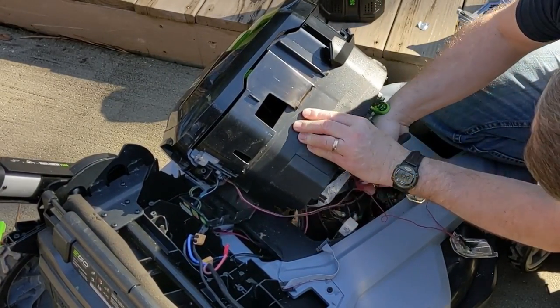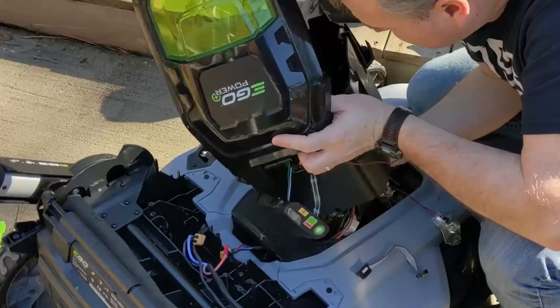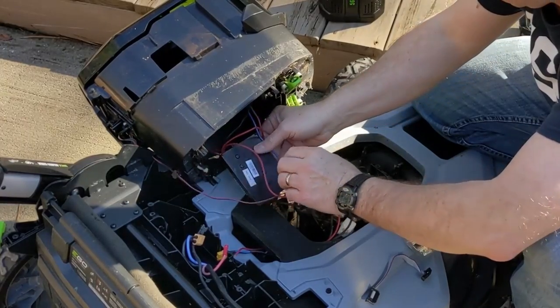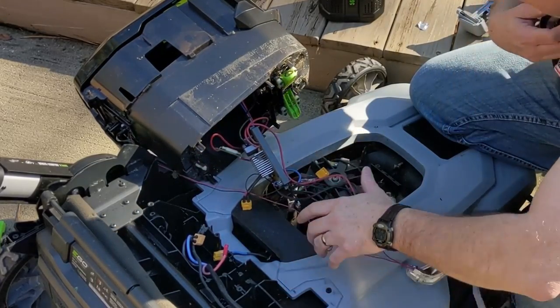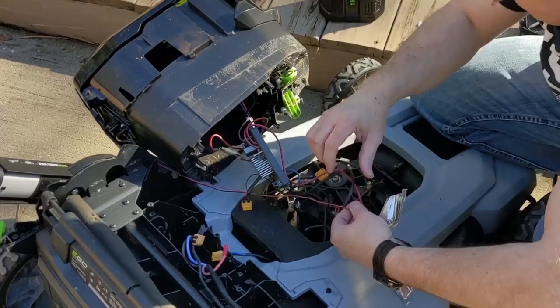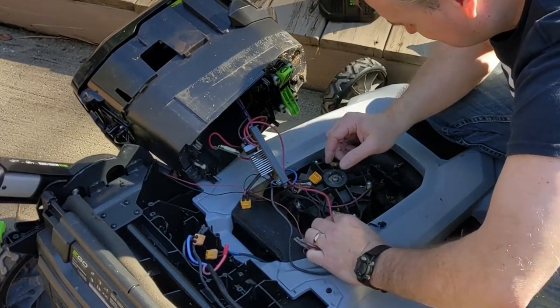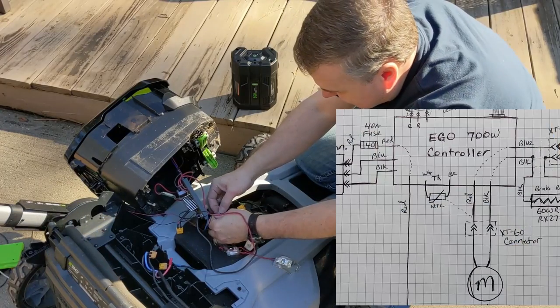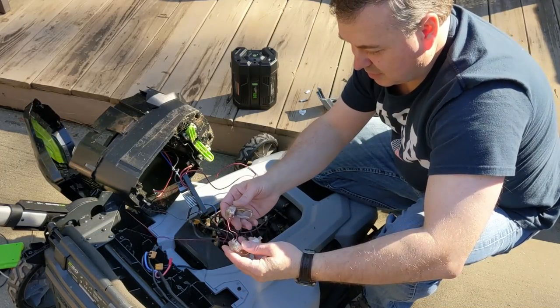There's definitely a tie wrap, and our fuse has to come off this little holder, and then we've just got the battery connector. I'm not even sure if this is more helpful but I couldn't get the camera in there while working. There's our braking resistor, and we have a thermistor here on our power wire — I've taken some of the aluminum tape off. That's our NTC thermistor, a temperature sensor on the wire. I was troubleshooting the LEDs a little bit; we'll go back to that later.